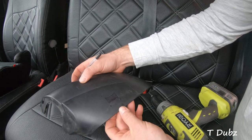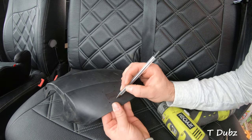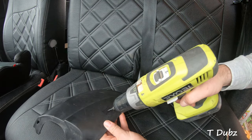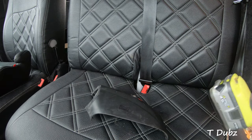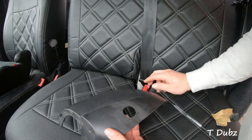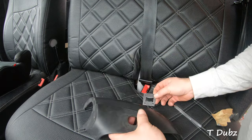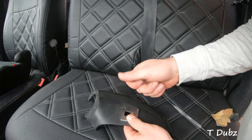What I'm going to try and do now is cut a circular shape around here — I might need to tidy up with a little trim tool, but that's fine. I'll need a hole roughly in the center to start with. Then I've used a file to make the hole slightly bigger so the plastic isn't visible, and I can also get the bottle head in to actually release the bottle cap. The next step is to make these holes four mil so I can test my rivets are going to fit.